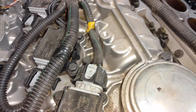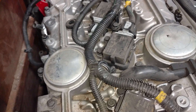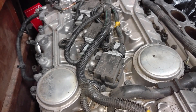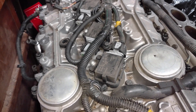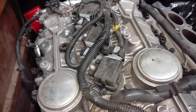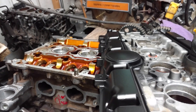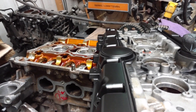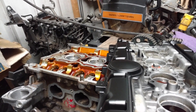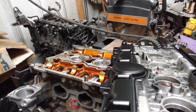and the top of it's like this, it likely has solid lifters as well, but they excluded the holes that you can use to inspect the valve adjustment. You've got to install the cover to do the valve adjustment before you call the head serviceable. At any rate, if you have solid lifters and you plan on reusing that head, you need to keep those lifters in order the way they came out of the head. That way, you shouldn't need a valve adjustment.